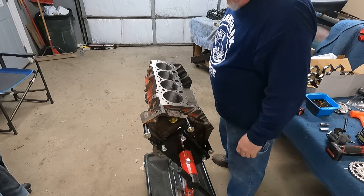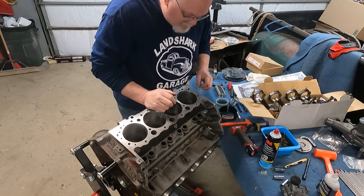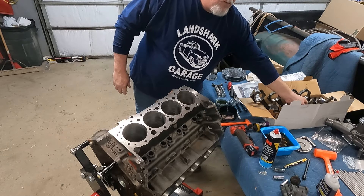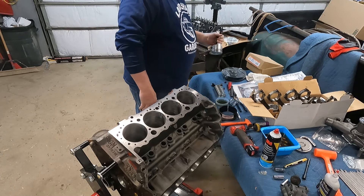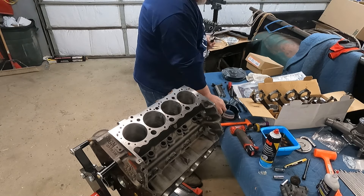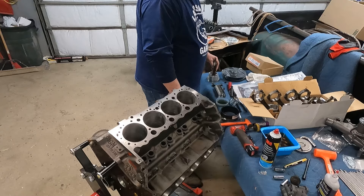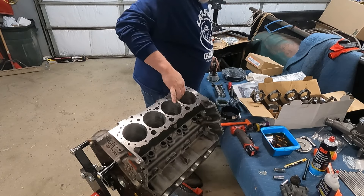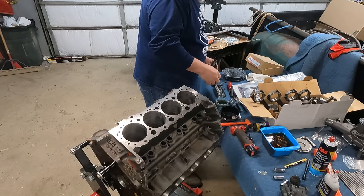This side of the block is 1-3-5-7, and 2-4-6-8 on the other side. I'm going to get one piston set in there and tell you how I do it — doesn't mean it's the right way, it's just the way I do it. I've got all my pistons marked to go back in; they're stamped, but it's a lot easier to see that yellow mark. Starting with number one. I have a little tray of assembly lube for the bearings, my ring compressor ready — a 4-0 ring compressor, really nice, I've had it for years. Works really good. I've got my lifters soaking.